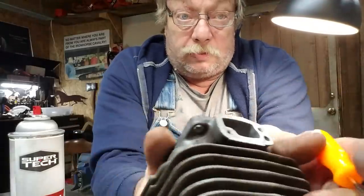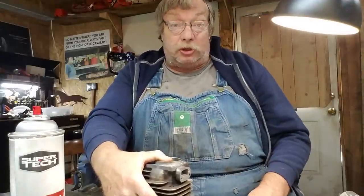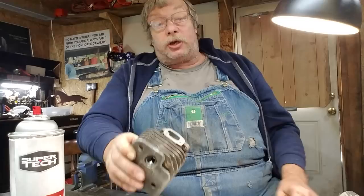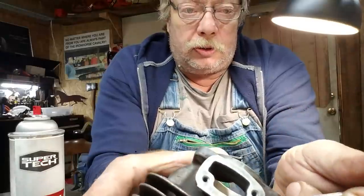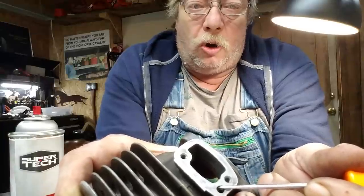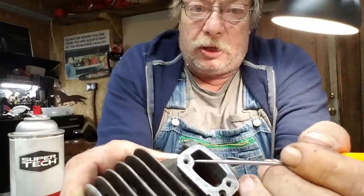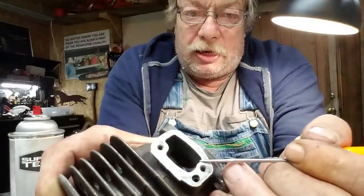Now when you're porting these — I don't care what it is, from the 262, 266, right on up through to 2100, 394, any of them — that picks the vacuum up for your impulse. Right there is your impulse. The area where you're sealing your impulse from here to here — don't reduce that. The same thing with this hole — don't reduce that, leave that alone. Same thing here. I've seen far too many of them that's been gouged and hogged, and they can't seal them up.